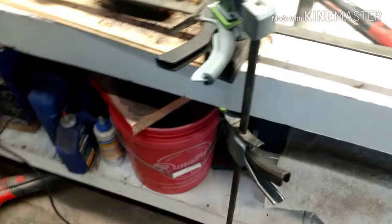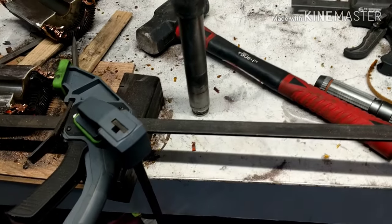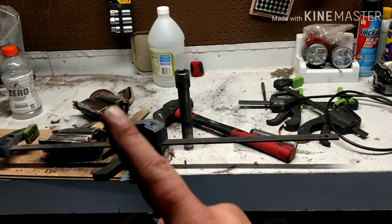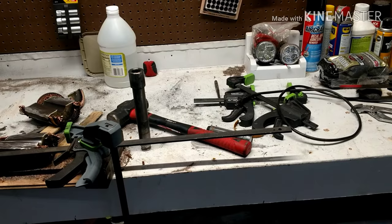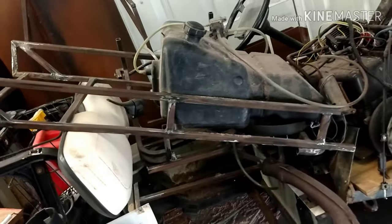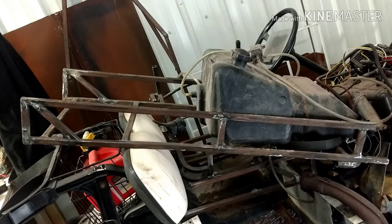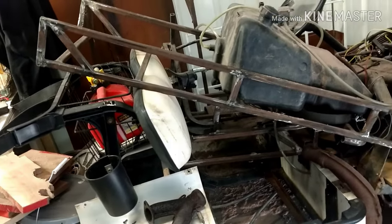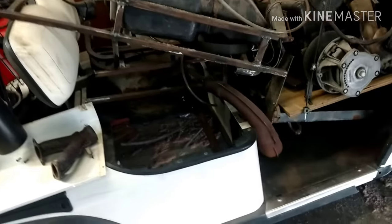So I'm going to put this on a jack shaft - an axle here and a bearing there - and put a sprocket right in the middle, and that's how I'm going to drive this thing. I also found out that that frame, which used to be on the Snow Dog, I ended up cutting it all up and salvaging it, and that's what I'm going to use for a subframe to mount the motor on, probably with a jack shaft and a belt in between.